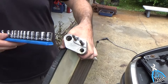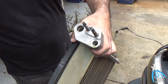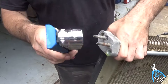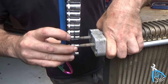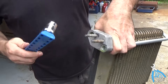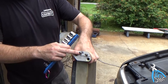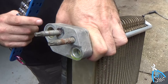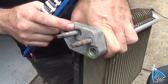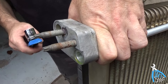Here's the studs I was talking about. On the off chance yours does not come with new studs — I think it was a four or five millimeter — it looks like a five millimeter does fit right on there. You could always use that to get those out of there. And if you strip that out or something doesn't work right, you could get really close to the base with a pair of vice grips, because the other half of the blocks that bolt on there are so thick — your nut is only clamping on the top half.